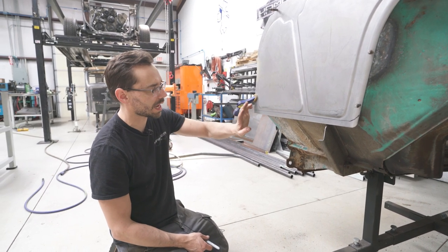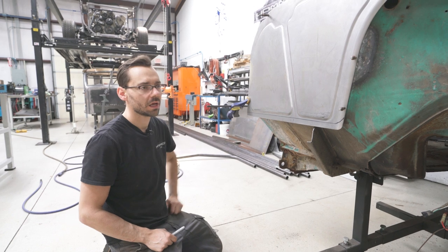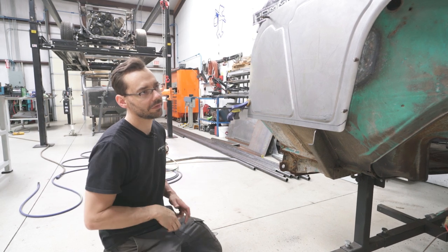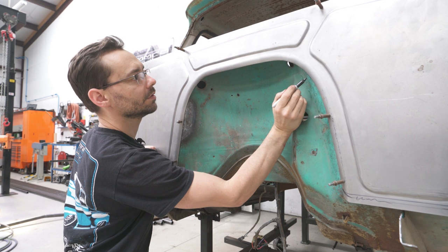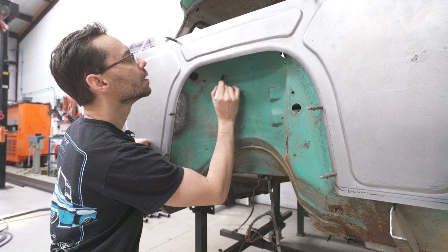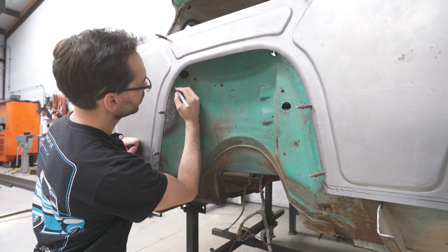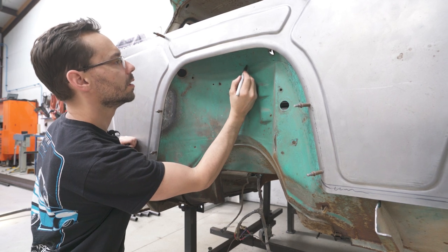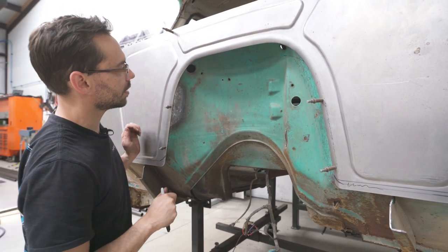Okay, we're gonna take this back off one more time, hopefully. Bend this on the bench by hand. That way, the angle of the toe board. And then we should be able to put it on, scribe the whole thing all the way around, take it off, cut it, and weld it on. And then the only thing we'll have to do later after it's welded on is basically like somewhere right in here, we're gonna make a piece that comes up here like this. And that's gonna work out good, because we can get rid of that hole. That little guy was in the way the whole time. Not anymore. I'm gonna get rid of him and that one. See, we're filling holes and making a custom firewall at the same time.